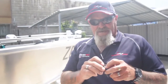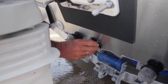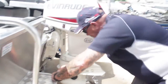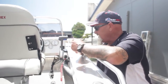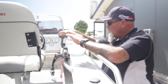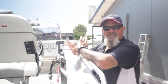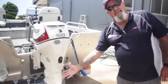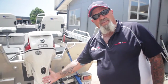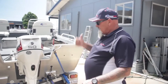The bung. Not much point having a boat that doesn't float, so let's take the bung off and put it straight in the back of the boat — nice and secure, just tighten it up, nice and firm. Keys in hand, let's try to start. With an Evinrude E-TEC it's a very straightforward operation — key in, we're in neutral. If it was in gear it wouldn't even ignite to start. Simply turn the key, and away we are running. We're looking for water coming out here, which shows us we've got adequate water flow in the motor. We know the impeller's working, the motor's started, the battery's not flat. That's our little checklist.